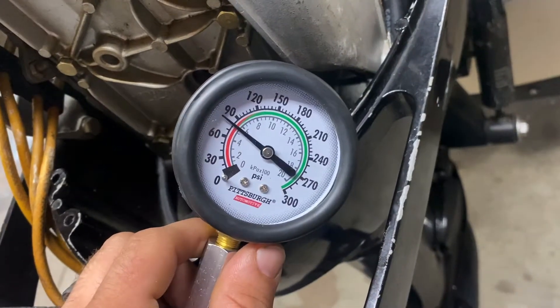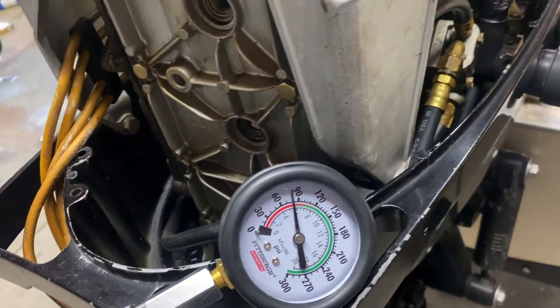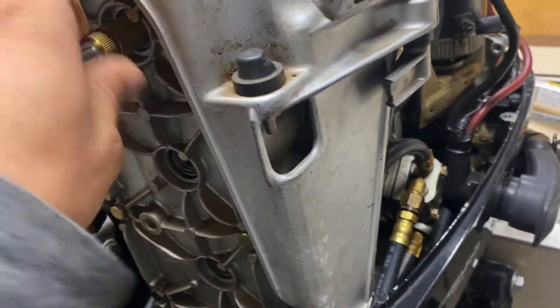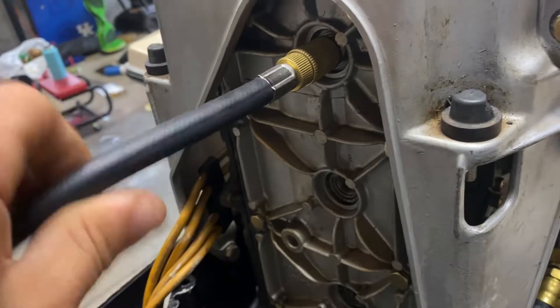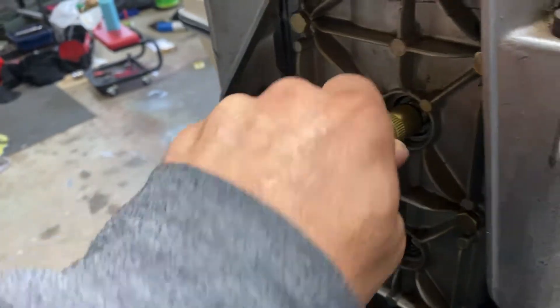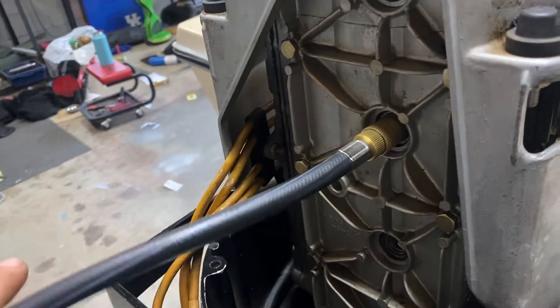Here's my read — I've been getting about 80 across all my cylinders. But normally your next step is to remove your hose. After you remove your hose, you just go to the next cylinder. After you snug this down, you just continue the process — and don't forget to reset your gauge as well.